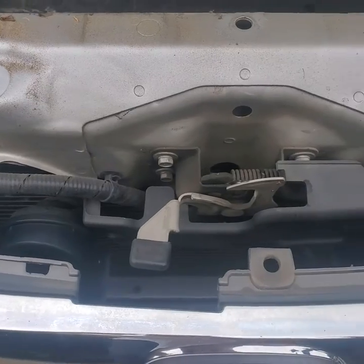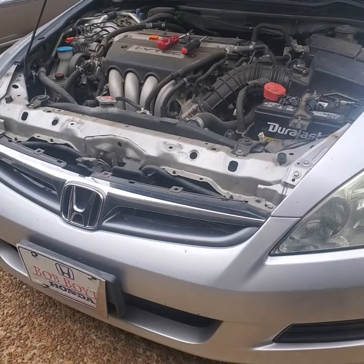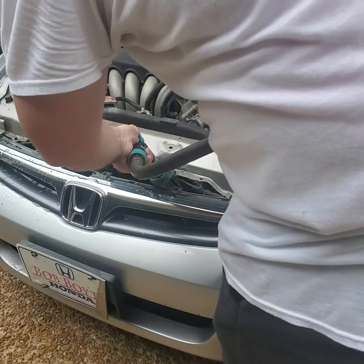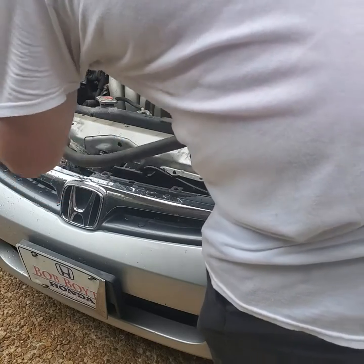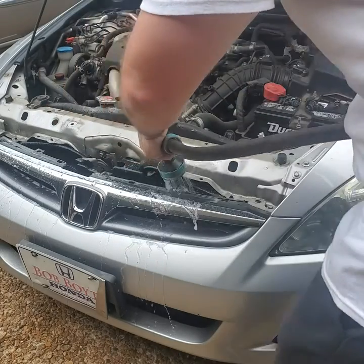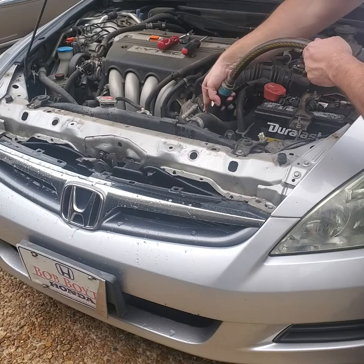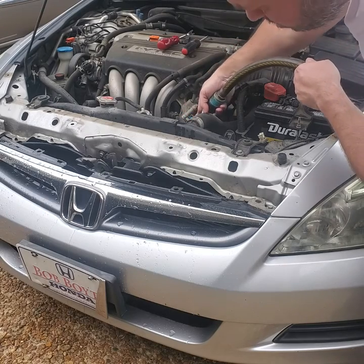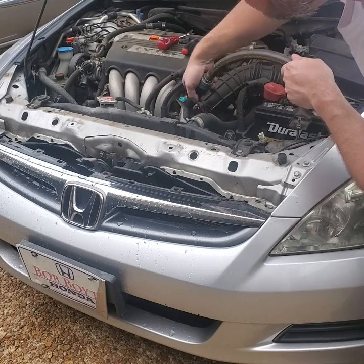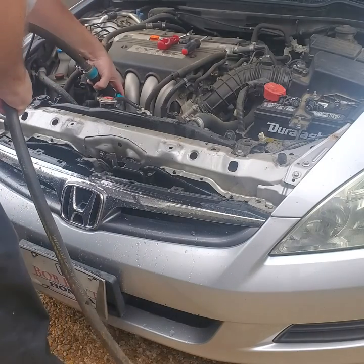You want to look in there and also try to spray in behind the radiator. Now we're spraying the radiator — we want to wet it down but we don't want to use a lot of pressure, because right now where we're spraying is the condenser. On most vehicles the condenser sits in front of the radiator, so that's actually where a lot of your airflow gets blocked — bugs and debris getting into the condenser. Now we're spraying behind the radiator and trying to spray forward to dislodge and push as much stuff out as we can, instead of pushing it in the way it got stuck originally.